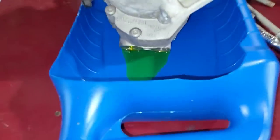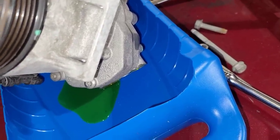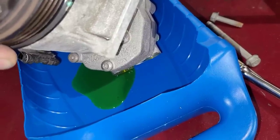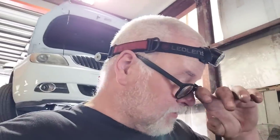I've actually spun this thing and all I've gotten is a little spillage — I mean, that's hardly anything. It's not even worth measuring, to be totally honest with you. I'm going to put a little sploosh — it's like baking at home and you just add a splish of this and a pinch of that. So let me uncap this, put a little bit of PAG oil in, make sure you use the correct recommended oil, and let's get this thing installed. Record how much oil came out when you recovered the system, and drain as much as possible from the old compressor.